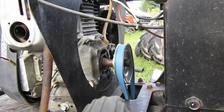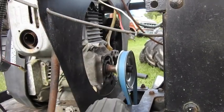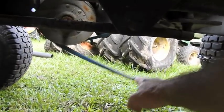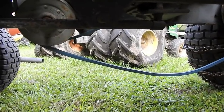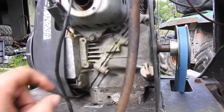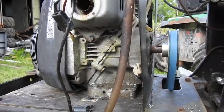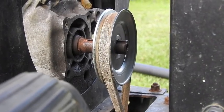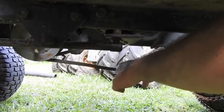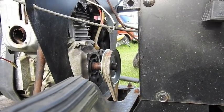I've got the 98-inch belt on, but the original engine was about seven inches from the mount point. This one's about four inches from where you mount the motor, so that makes my 98-inch belt too long. We're going to take that off and try to find a shorter belt, or take that one back and get a shorter belt. We could also jack the engine up three inches — that would keep it out of water better. I'm thinking shorter belt right now. I found a belt in the garage that was slightly shorter. It might be a little loose but good enough for a test drive — gives us a good place to start on finding the right belt.